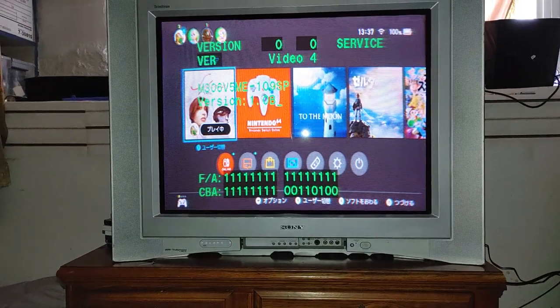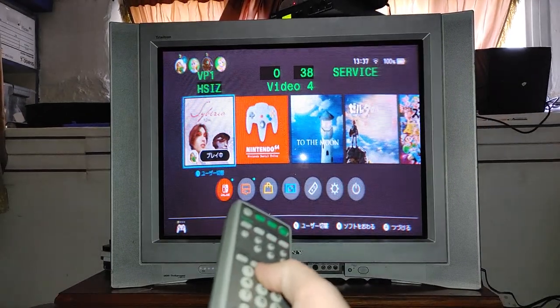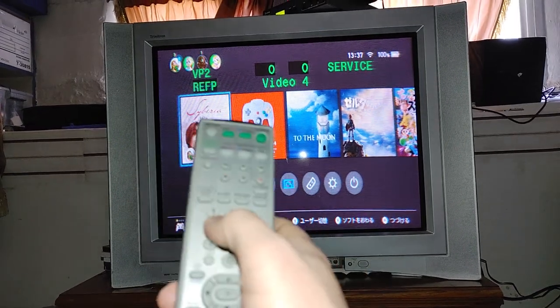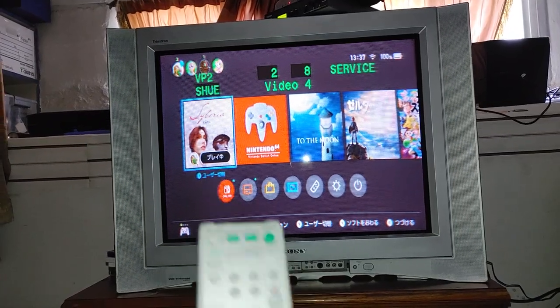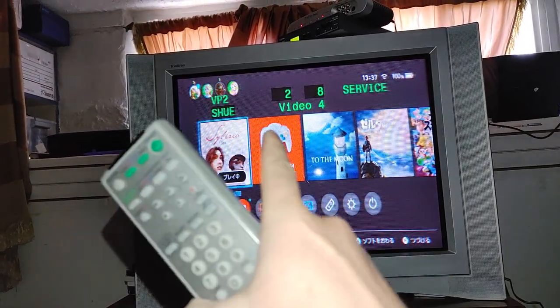Within the service menu, there are several different sub-menus. To cycle between the sub-menus, push 2 or 5 — 2 goes up and 5 goes down. And then within each sub-menu, there are different settings. Push 1 and 4 to go through the different settings within each sub-menu. Then 3 and 6 is how you actually change the values for the settings.